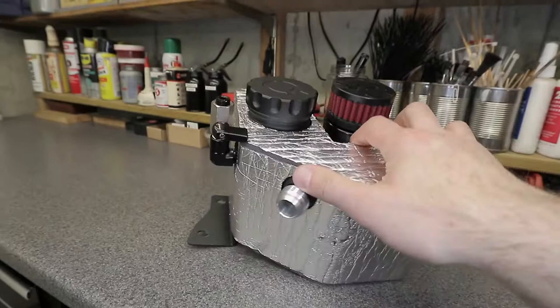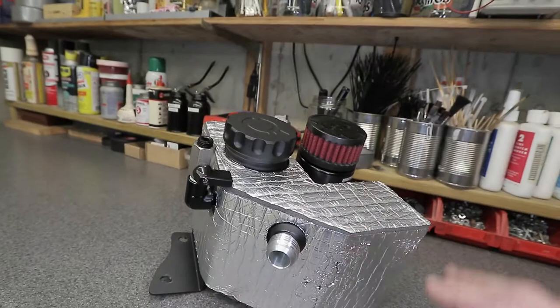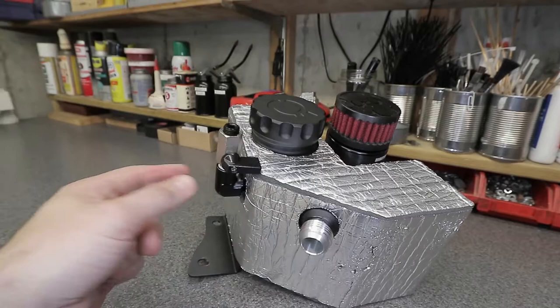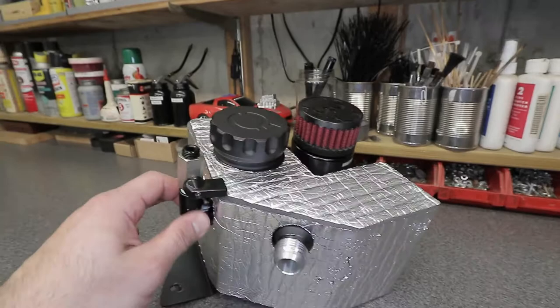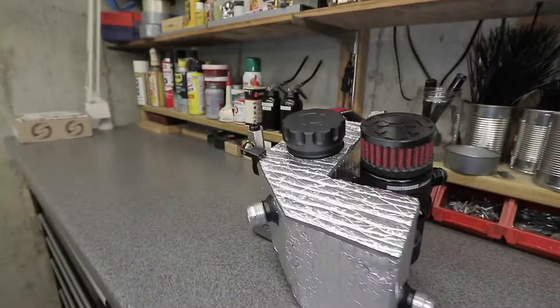This is the CPR tank — it's highly modified. I had issues with the threaded cap not sealing when I got it. After going back and forth I received a new cap and a new tank, which addressed that issue. Then I went forward and added my own fill port because my custom intercooler system isn't anything standard, so I need to properly fill it — I'll remove that plug and fill from there with a hose, funnel, and barb.